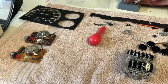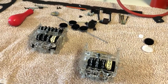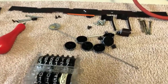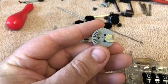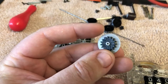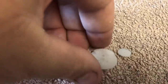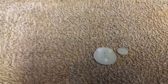Alright guys, welcome to part two of the odometer saga. On part one I removed the EA odometer, put it in place on the EB and it worked well, but then when I went to drive the car the next day the odometer stopped working. I stripped it down and these are the gears that were in the EA version - they basically disintegrated and were no good. After seeing that I went ahead and purchased some new gears, and those are the new ones here.